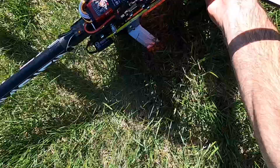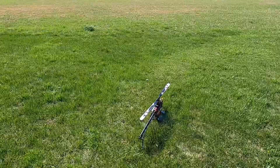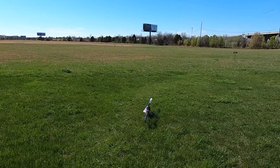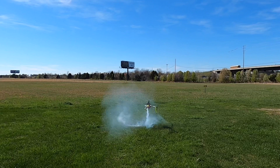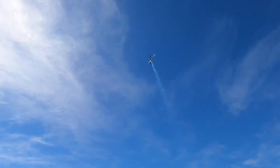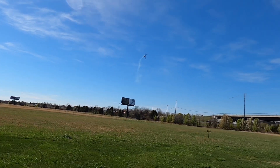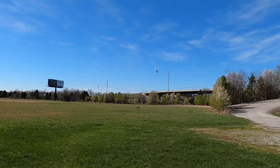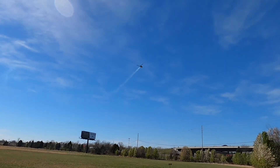One click leaner. We're going to feel the back plate — still feels good. Now we're going to do another pull, and if I'm happy with that high speed we're going to start on the mid range. Our idle is still perfect. Smoke staying consistent. It billows a bunch at mid — that's okay — but our high speed looks great. I'm pretty happy with the high needle setting.